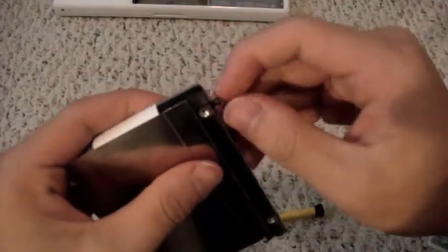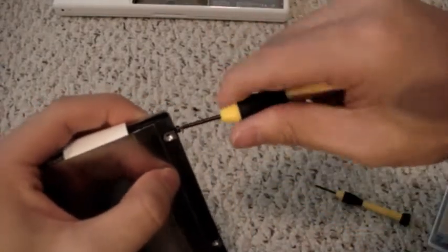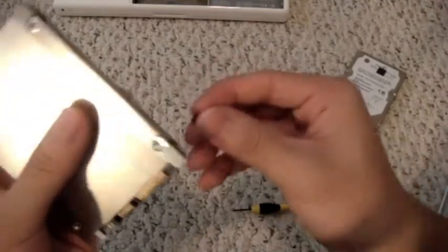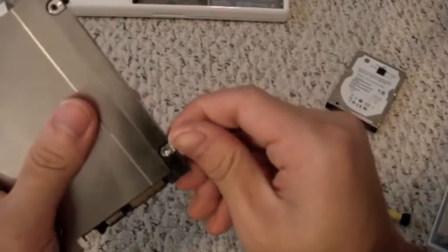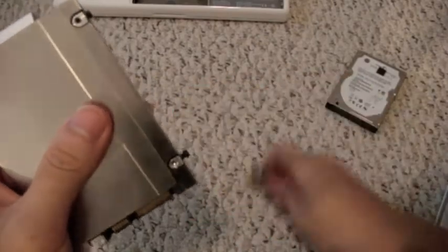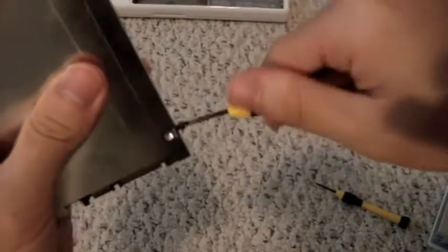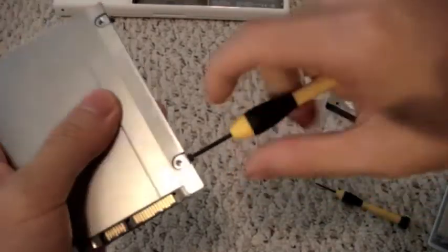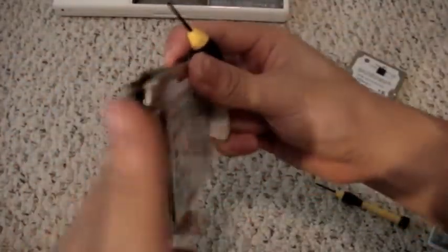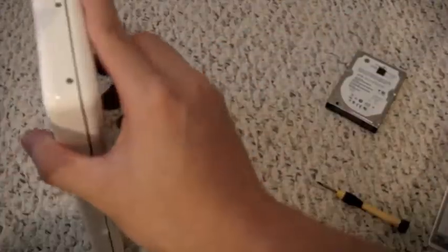There's one more important thing to remember: before you touch any computer parts, be sure to ground yourself and have a stable surface that does not conduct electricity. While this is a carpet, it's not one of those cotton or woolen carpets that creates static. I also have a grounding band you can attach to a metal surface such as your wall outlet, which you can get for about $5 on Amazon — that automatically reduces any risk of damaging hardware.